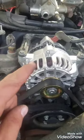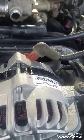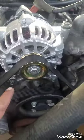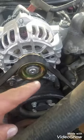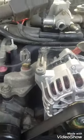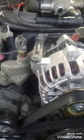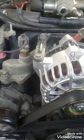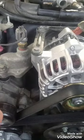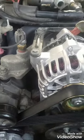I got the bracket back on, the wires are back on, these bolts on the bottom of the alternator are on and tight. Everything's tight. I didn't torque them — you just kind of make them tight, feel it. You don't want to over-tighten them, just make sure that they're snug and then do like another half turn after that, maybe a full turn at the most.